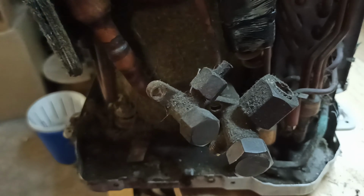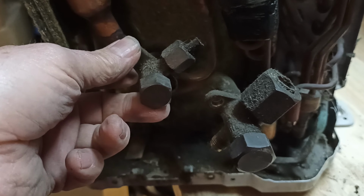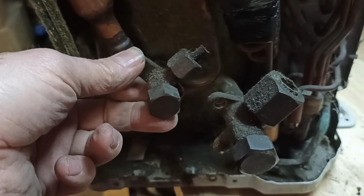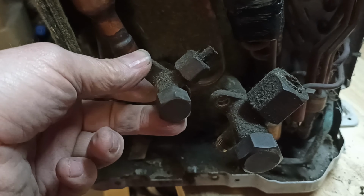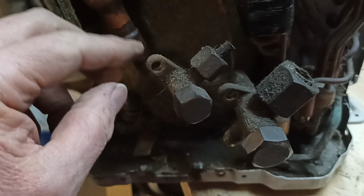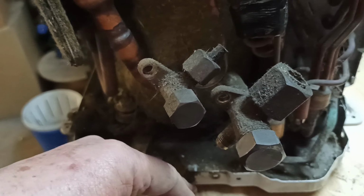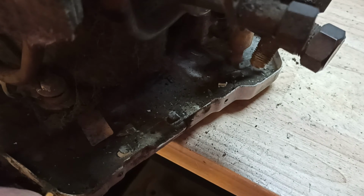So there was a panel coming up here of sheet steel. These charge and discharge pipes were sticking out of that panel. They were held in by a couple of 10mm bolts. Whipped them out. There was a couple more Phillips head screws floating around, so I took them out, and then the trick was that the whole thing just slid sideways to get the panel out. So that was okay.